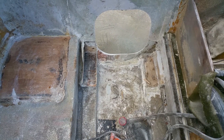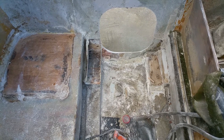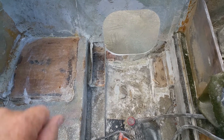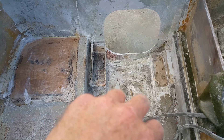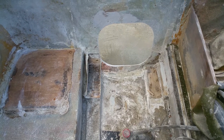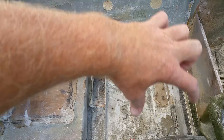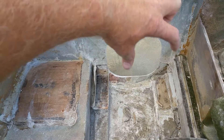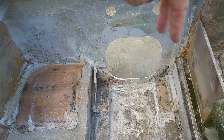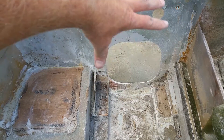If you see the nails, get the nail bar just in between them, along with the grain, and split the wood. If you hit it hard enough you'll split it — especially where the nails are — split it in half and lever it up. Try not to put too much stress on the back transom because it's only about 10 mil thin. Put the claws in with the grain going that way — it's like two four-by-twos stuck together — hit the claws in there and break it apart. It will split and you can just dig it out.